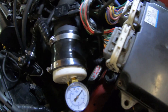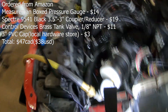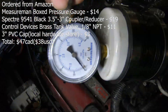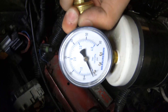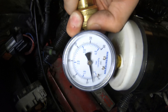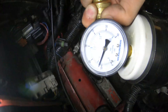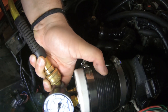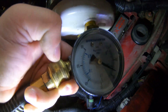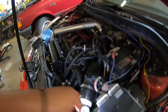Let me show you the tester working. I built this myself and I'll include the full parts list — if you're in Canada, it's a good cheap DIY option since pre-made testers aren't as readily available here. We're climbing past 10 psi, sweeping up, just about at 15 — and that's where the MAP sensor starts leaking. Look at the swelling on this coupler. We're touching 20 psi and nothing else is leaking. Just a little from the MAP sensor, so I'm calling this boost leak test successful.